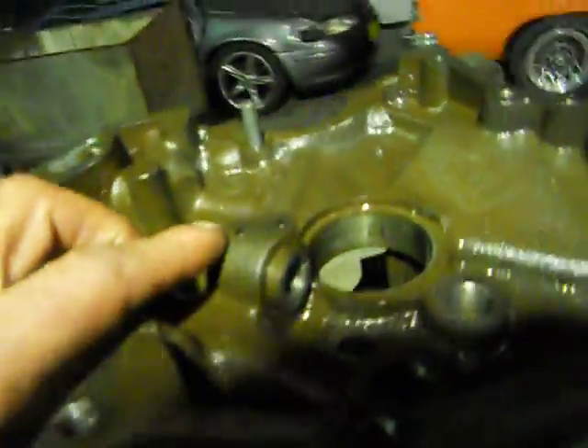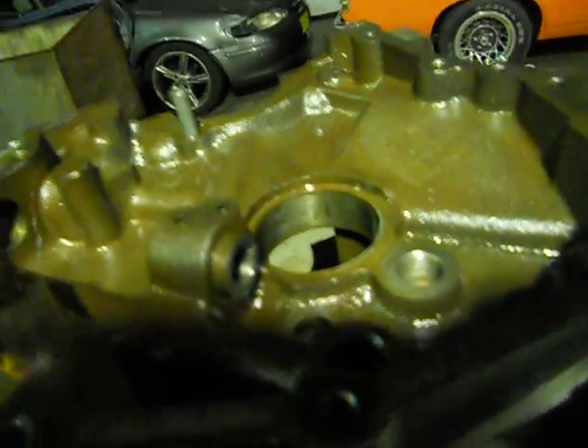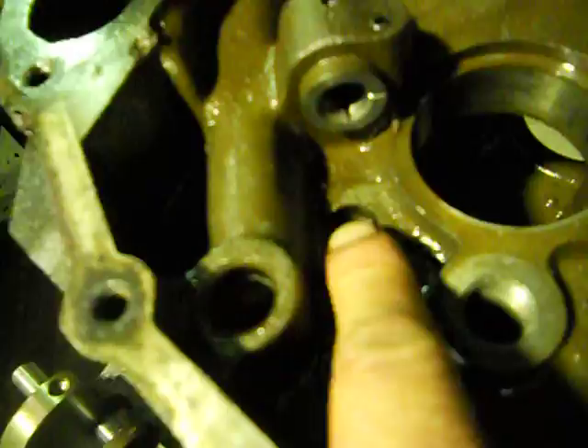There's the manifold - everything's just been stripped and put through the tank. A couple of things: the oil pump drive shaft has been taken out so you can get to the galleries, and all the gallery plugs are removed. I remove all gallery plugs.